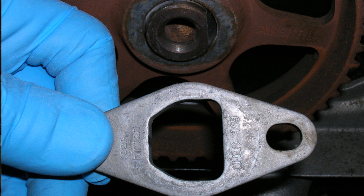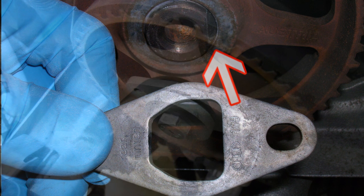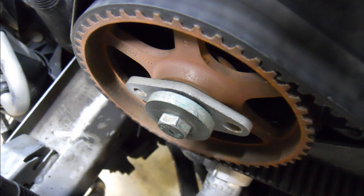When the diamond-shaped washers are removed, there will be a large flat spot on the cone of the camshafts. This is also a timing reference. These flat spots always point inward. Always make sure the diamond-shaped washers map properly to the camshaft when being installed. If by chance the camshafts move, manually turn them back into place. During reassembly, the tapered camshaft pulleys must be loosened to properly set engine timing and timing belt tension.